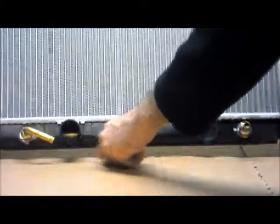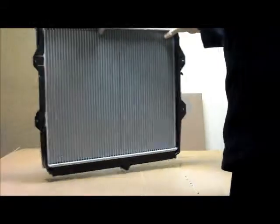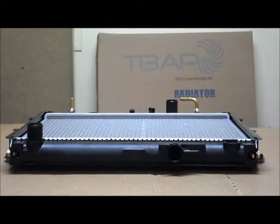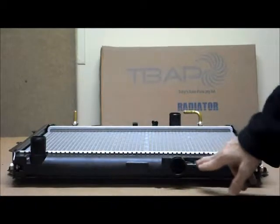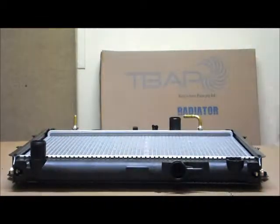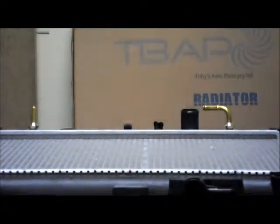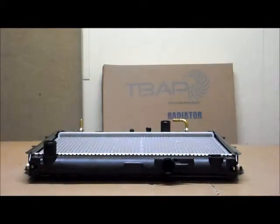Directly in the centre you've also got the drain. Now, turning it around — this is the front of the vehicle. So if you were standing at the very front of the vehicle looking into the engine bay, this is the top view you would have. You can see that towards the passenger side of the vehicle is where you find your cap, with the overflow pipe facing towards the passenger side on the outside. On the driver's side is the top hose, and looking down towards the bottom of the radiator, on the passenger side you find the bottom hose.